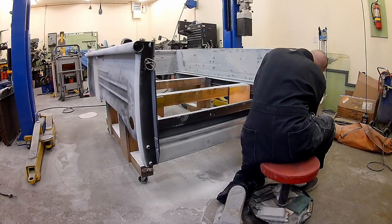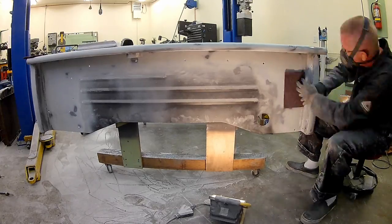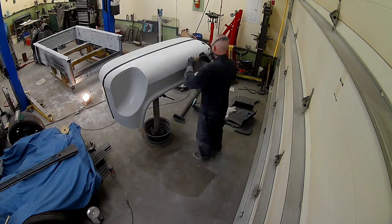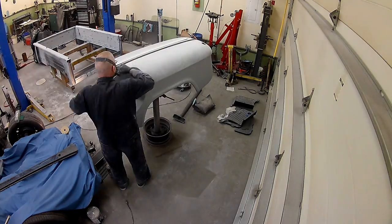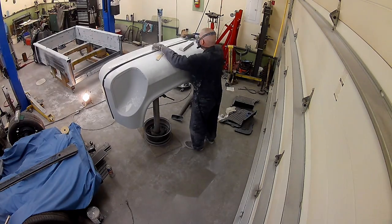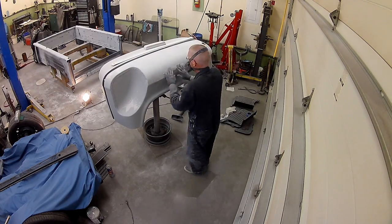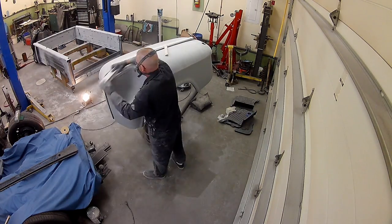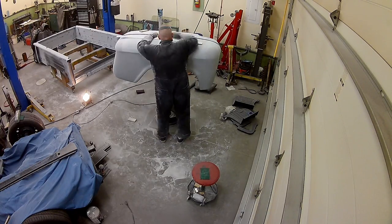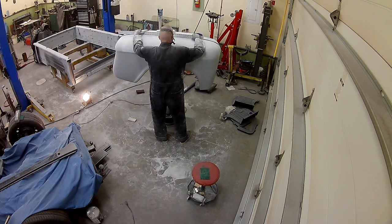One of the advantages of using the slick sand is instead of having a whole bunch of applications of filler with varying degrees of hardness, you're just putting down one big uniform layer. If you were to try to patch it all together and try to make it perfect with different applications of filler, you're going to chase it forever. By the time you're done, you might as well just put a skim coat of filler on it. Slick sand is a skim coat of filler that comes out of a gun. And I learned in sanding that it seems to be really hard on my body — like there's sanding muscles that I haven't been using, and it really took its toll on me.